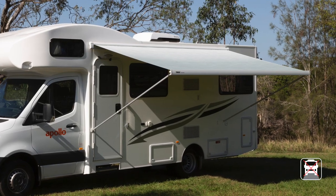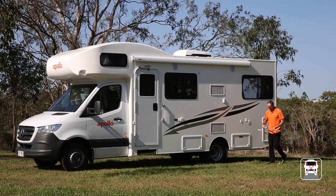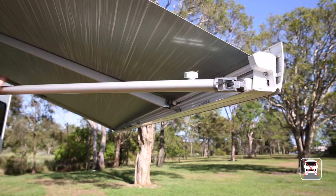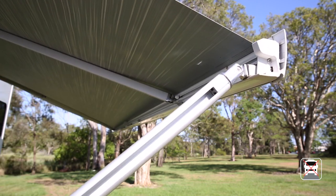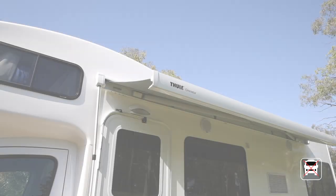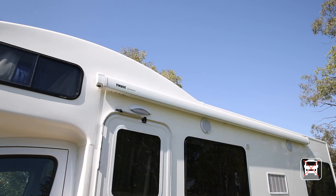The awning is a sunshade only — it's not to be used in windy or rainy conditions. To operate it, get the awning winder arm from the rear compartment, insert it and turn until you can reach the awning. Release the leg by pulling it toward the knuckle, swinging it around, and twisting 90 degrees, enabling you to tilt the leg down toward the catches on the RV. Slide the lock down, extend the legs to the desired height, and lock off. Pack up the awning before moving the vehicle, and once retracted don't wind further as you may cause damage.